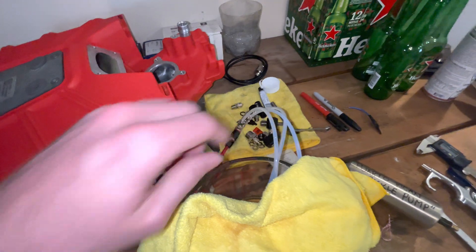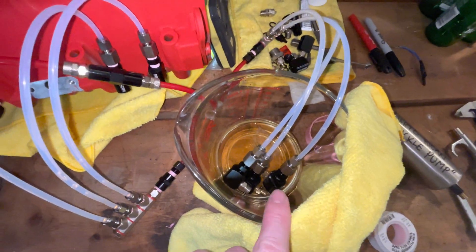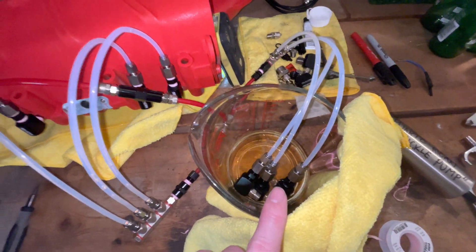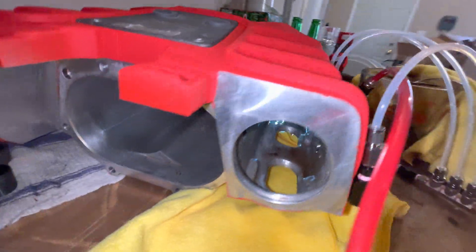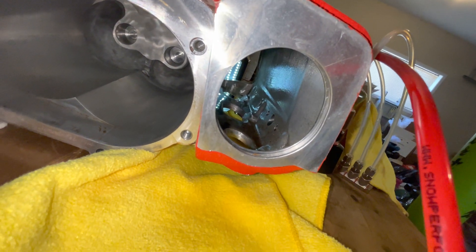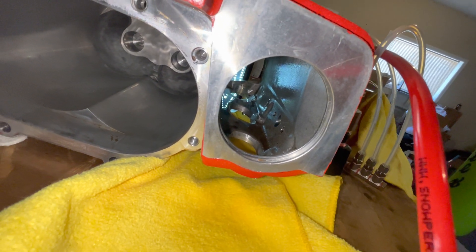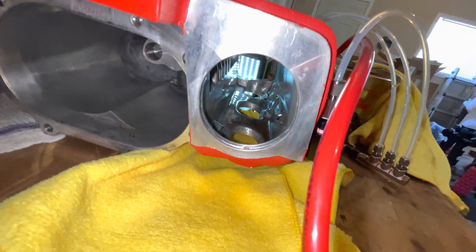Basically it just helps with the delay and lag, and then that goes to three nozzles which are going to be fixed like this on the other bank. Inside, you can see we've drilled into it below the intercooler. I'm just going to give you a little test as to what this is going to look like - this is at 150 psi.